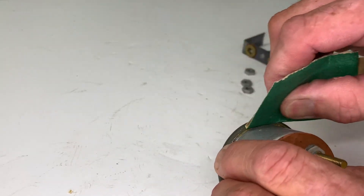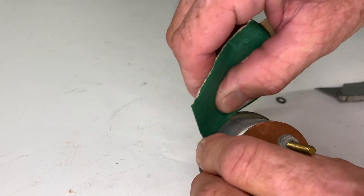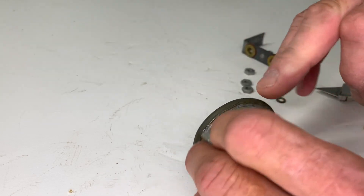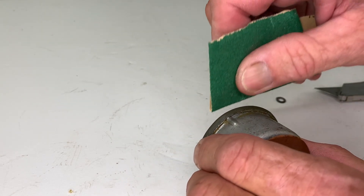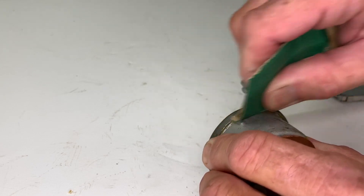Right between the bezel and the housing of the fuel gauge, you'll notice there's some sort of little sealant between the two surfaces. I'm going to take a utility knife and scratch the majority of that off, then take a piece of 80-grit sandpaper and really clean up those two surfaces and the painted surface on the bezel, so that will make a nice contact to bare metal in the dash and will create a ground. We'll put that sandpaper right where the two surfaces meet, scratch it up and get it as nice and shiny as we can — you just want to keep that sandpaper in that joint and clean off the area that's going to be touching the dash itself.